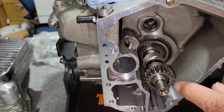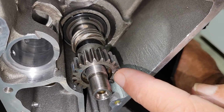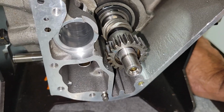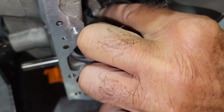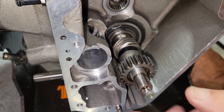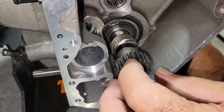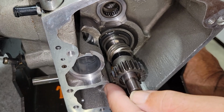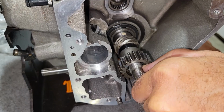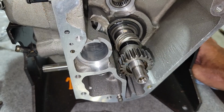And the other thing that's missing is this nut that goes here. Oh, okay. Up until 1992, it used the same nut that's in the 56. Like the 58, right? 58 right-hand side. 58 and later, I should say. Yeah, because it's got 2 flats on it, and it turns in. And then in 93 and later, it's got multiple sides, like a socket will fit it. And I'm not so sure if they changed the threads. Like maybe they don't interchange. I'm not that up on that.